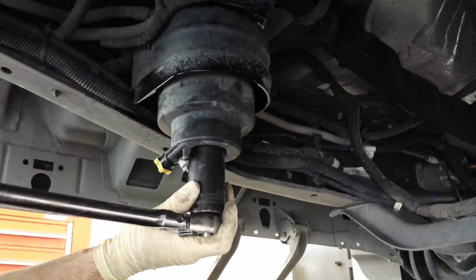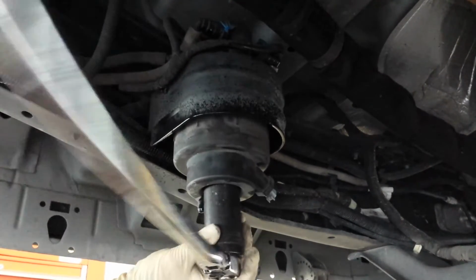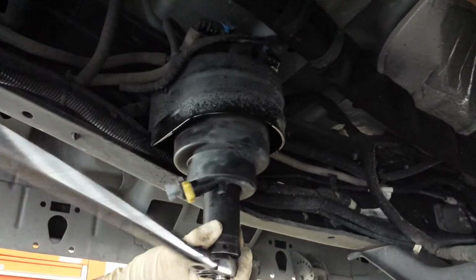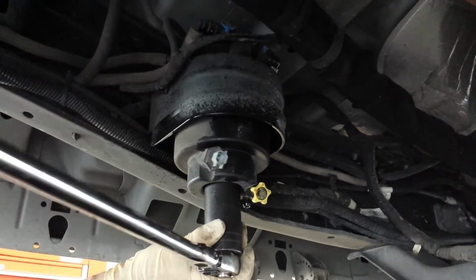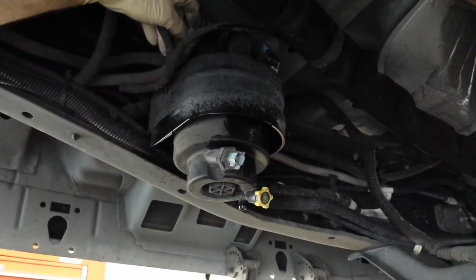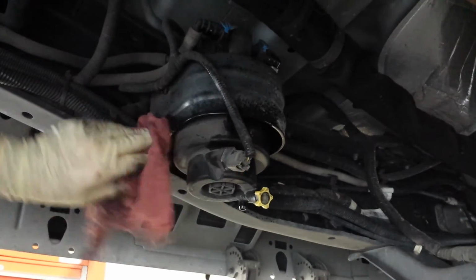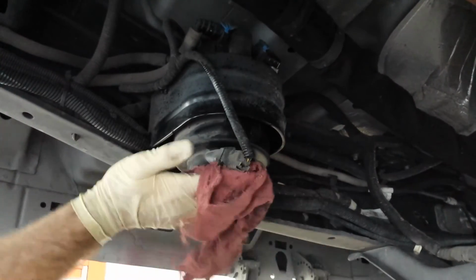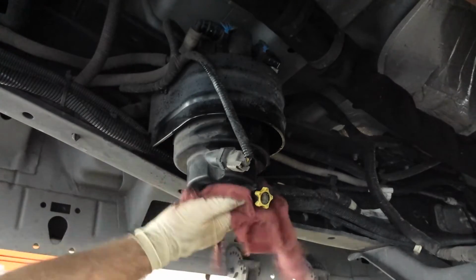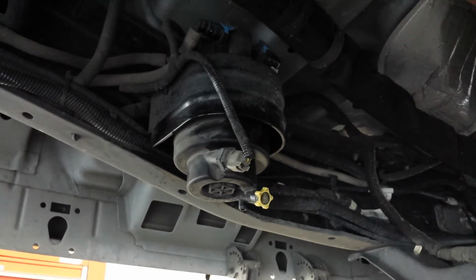And when we tighten it, we just got to go nice and easy so we don't break our tab when we bottom out against it. It lines up the connector. So we should be getting close. That's it, as far as she goes. If I was at mid-swing with that ratchet, I could have easily broken that tab. It's kind of critical to have this thing tightened correctly, because if it sucks air, the engine will run okay, but man, she makes some noise. She'll hum and do all kinds of weird things. So let's go look at the upper secondary fuel filter.